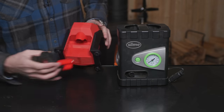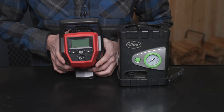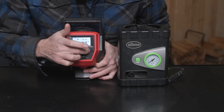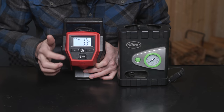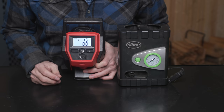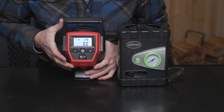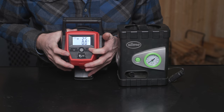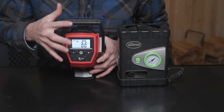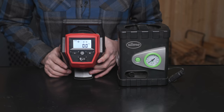I've got to put the battery in it. I've got a 6.0 and a 3.0 — you can run any of the batteries. Turn it on. The coolest thing about this is that, let's say I want to run this up to whatever pressure I set — the compressor is automatically going to stop at that pressure and not over-inflate. You have one button to turn it on, a plus and minus for pressure, and if you press and hold it will jump in increments of five. On for the electronics, on for the compressor. And if you get confused and need to back out, you just turn it off and get a second crack at it.